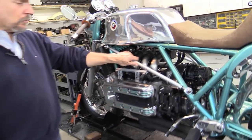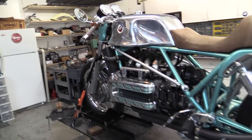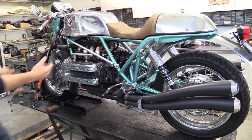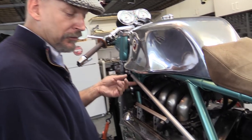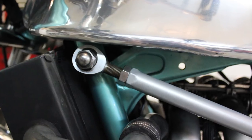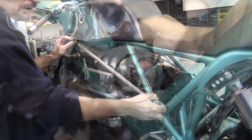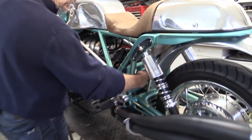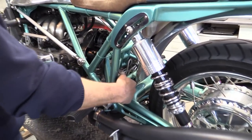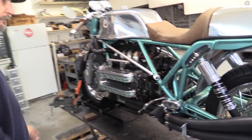But if you put your hand down on the frame, it's buzzing like crazy — and it works beautifully, that was the whole idea. Because the control arms are cantilevered — they're on posts offset from the frame — they can't work quite as well as full stress members, but still it's enough. With the triangulation and the additional structural members on the frame, it's very, very rigid.